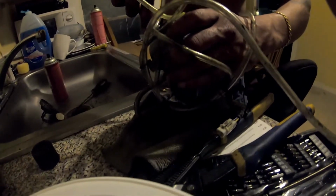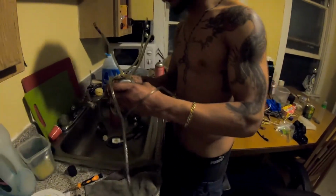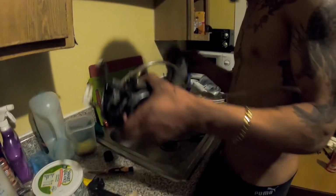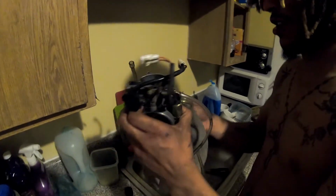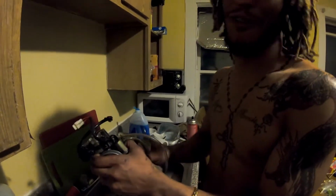All right, so we're tightening up these screws. You don't have to go too crazy. The carburetor screws should just be nice and smooth. The carburetor is not going to take any impacts, so it's not necessary to tighten that to your maximum strength. You just want to put snug all the screws on your carburetor. Wipe your carburetor down, you nasty, lazy people.